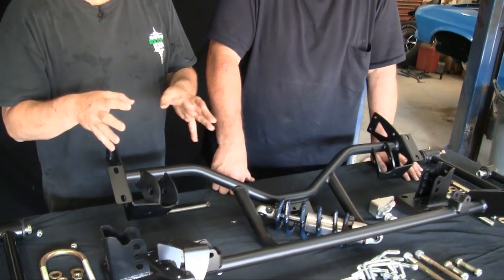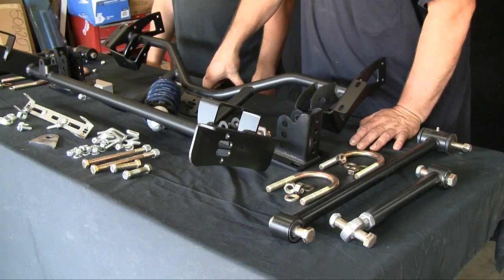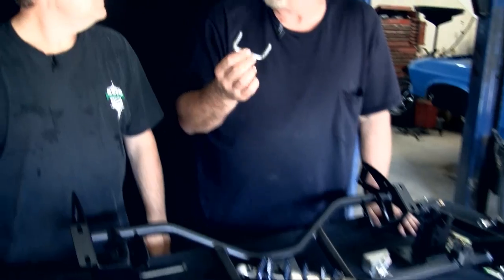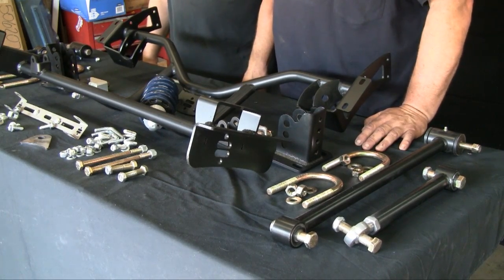There's not going to be the ability to drive because the car we're working on is a little empty — in the process of being restored, ground up. It's going to be a very cool car with a lot of horsepower. A lot of guys have added sway bars to their cars, so it uses the same similar idea where you drill the holes in the frame rail, run the bolt through, and secure it up. And if you like, you can come back and weld it in as well — and we're going to do that, given the horsepower the car has.